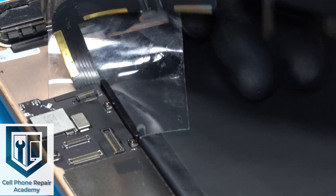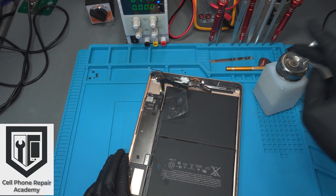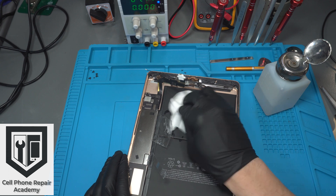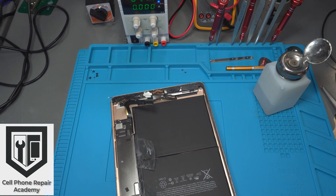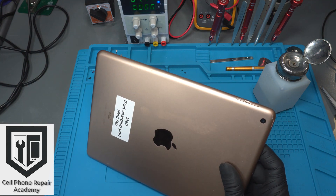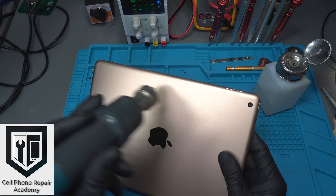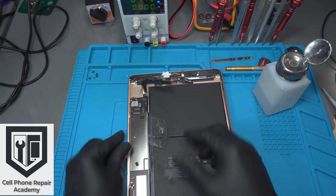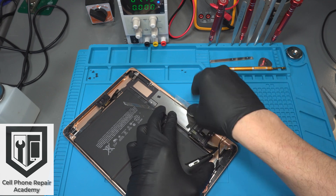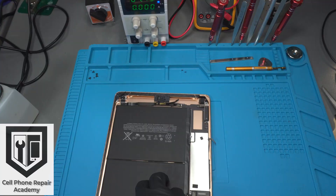Dab some alcohol on the plastic film and insert it under the charging port in a continuous downward motion. Continue to dab alcohol on the film and work your way down — we cannot move the film back up, as this will cause damage to the traces on the board, so just remember to continue moving downward. Once we get to about halfway, we use our heat gun and apply heat to the back of the housing where the motherboard is located at 300 degrees Celsius. Steer clear of the back camera as high heat can damage it. We continue working our way down the motherboard with the plastic film, skipping the battery connector area, and continuing down and around until the motherboard is released.